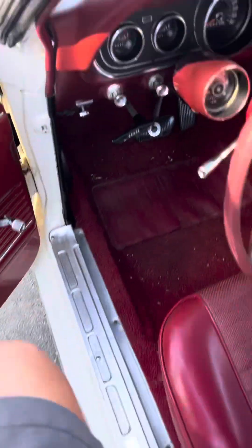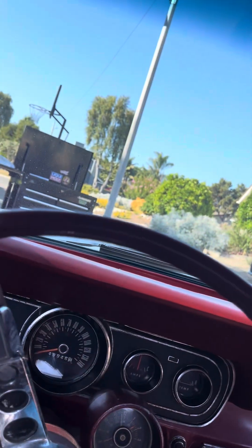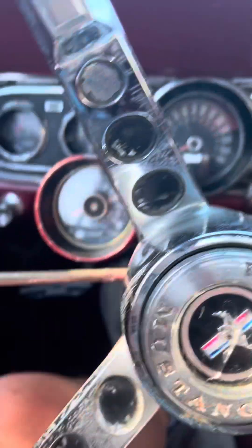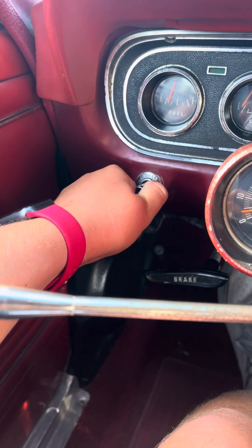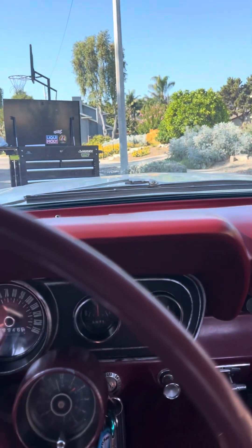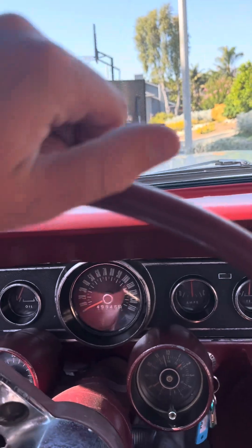Have you ever gotten into your classic Mustang and realized there's fog or water on your window? You go down to reach the wiper button, but instead of turning it to turn the wipers on, you pull it. You hear that? That is your windshield wiper pump. I'm going to teach you how to install the rest of the parts so that you have fluid shooting up on here to clean your windshield.